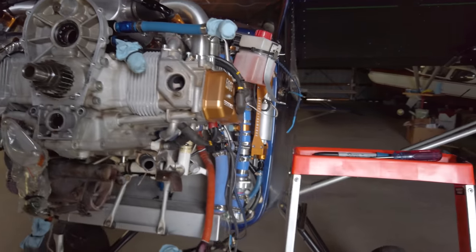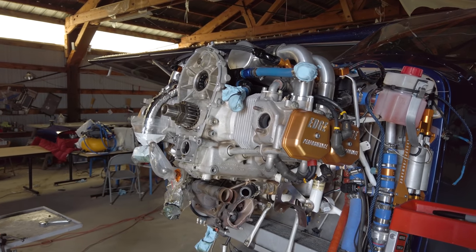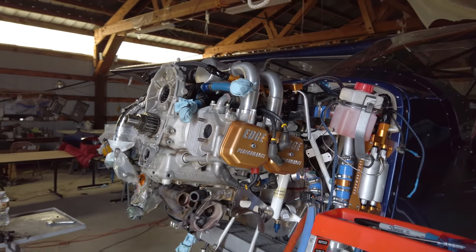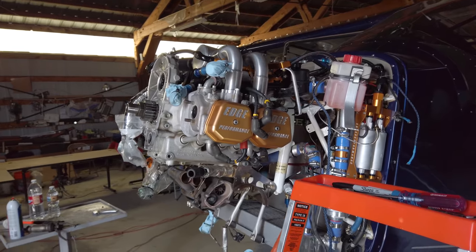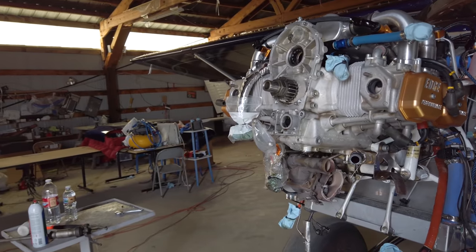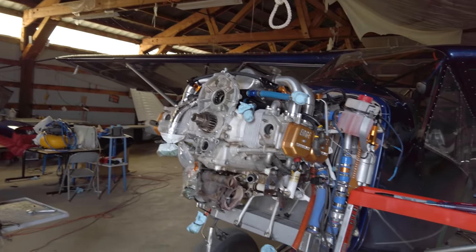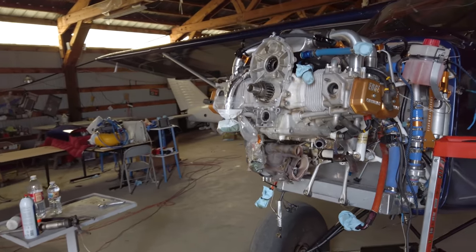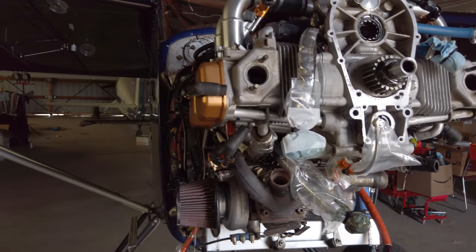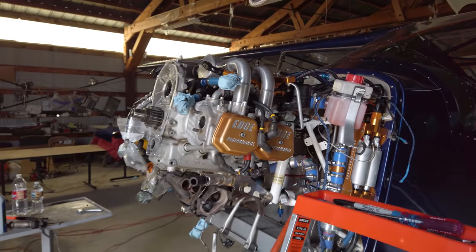And the advantage to doing that is, Rotax cylinders are really good. They have an extremely long life, really don't wear out, and typically don't use any oil to speak of. So it's an affordable solution to maintain all of those positive features, get a little more displacement, and have the right compression ratio. Obviously, aftermarket Edge big bore cylinders have a lot of advantages and have their place for doing certain things. But in this case with boost, that's a hard combination to beat for the money. So I'm going to try to swing that if I can afford it.